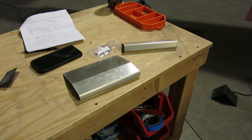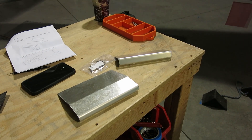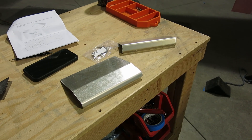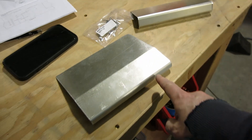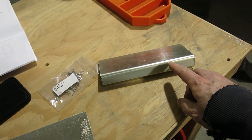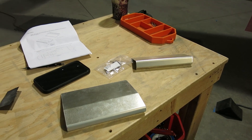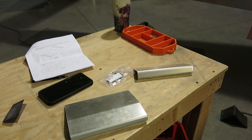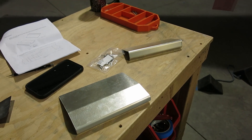I keep referring to this as a service bulletin — it's actually titled an airworthiness directive, which I thought was only for certified airplanes, but anyway, we're getting going on this. We've got our parts cleaned and applied anti-chafe tape to the front, the part that goes against the spar, and the part that goes against the tank. Check out Eddie Gill's video on that — he's got a really good video. This looks like a pretty simple install.